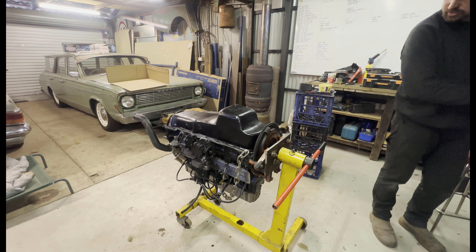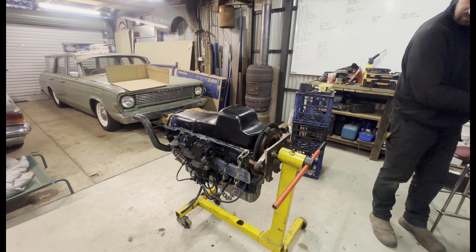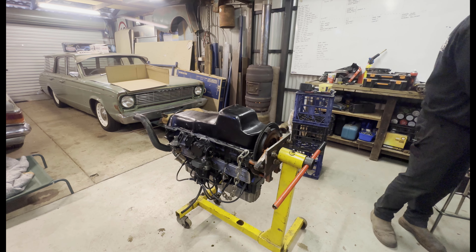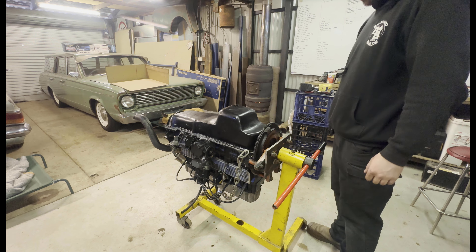This is me making sure it never leaks again. The packaging says to leave that for an hour before putting torque on it. I'm going to leave it overnight and put torque on it in the morning, because I'd like to get a little bit more compression out of that cork and that goo.